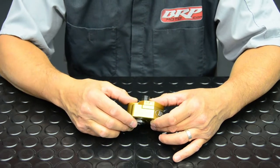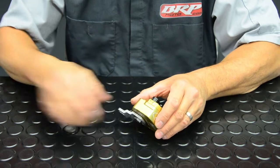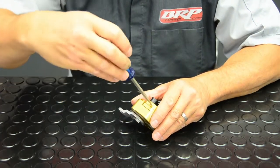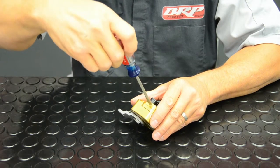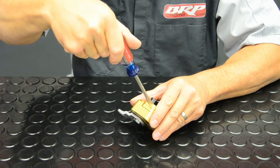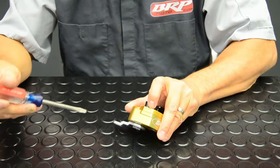We personally like to run the Scott stabilizer at 12 o'clock. I'll illustrate how to adjust this easily with a screwdriver. You can turn it and it will continue to turn as much as you need — it doesn't loosen or tighten, you just set it. There's a tiny chamfer there; it's set at 12 o'clock.